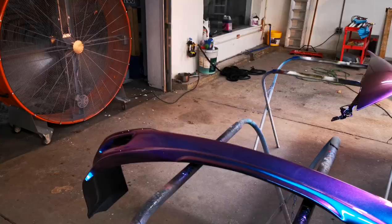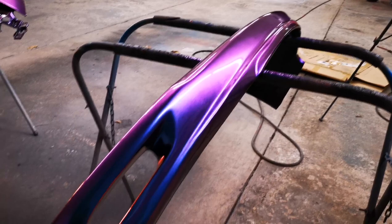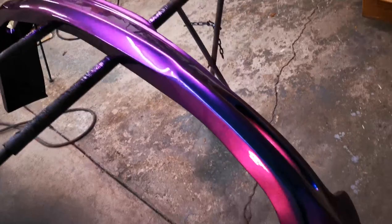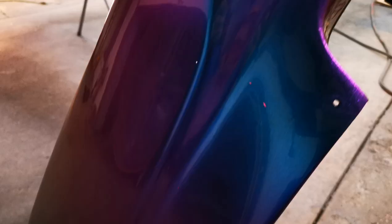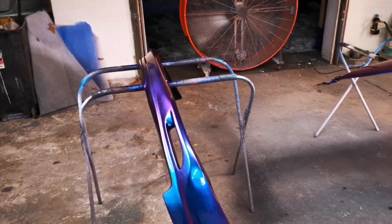This is how you do chameleon: two coats of Jet Black, make sure you sand to 800 grit before you put your Jet Black down, two to three coats of chameleon after that, and two coats of clear — and you're done. It's that easy. Whether you're a DIY guy or a professional auto body technician, these products are designed to work with you, not against you. If you guys are looking for the best, most affordable auto body products in the world, head on over to www.speedocoat.com — they have everything you need to get your projects done.